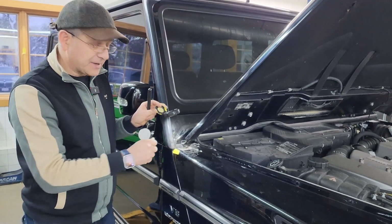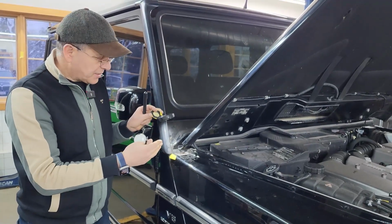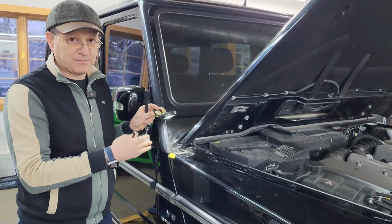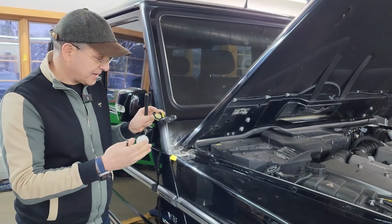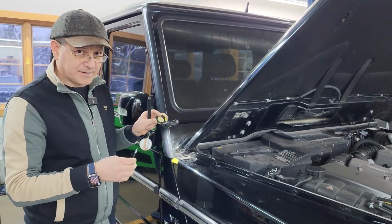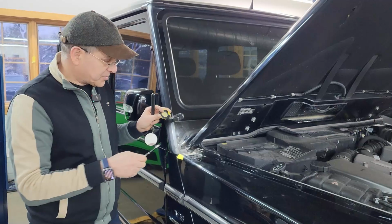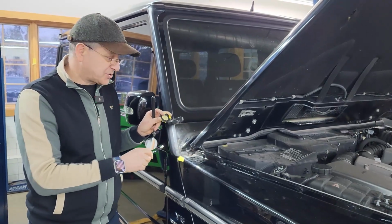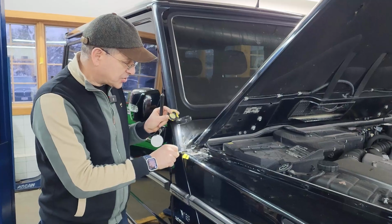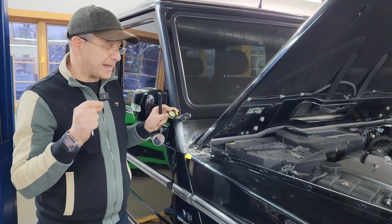One thing about this area, it's not a structural component. So theoretically, this is not something we'd do, but you could stuff it with body filler and it might last for maybe even a few years, but it's questionable, it's not going to last much longer. The other option, we can do a fiberglass patch, which is going to last longer, but we even have a better option. We're actually going to install a metal patch with a metal bonding agent,